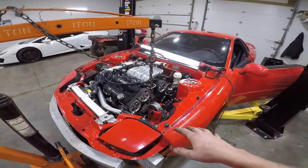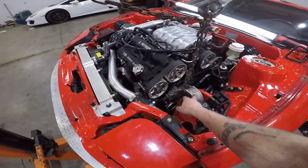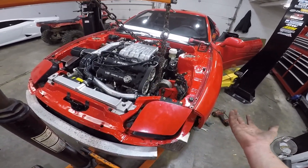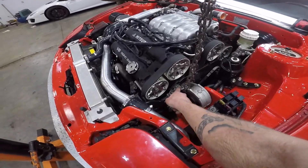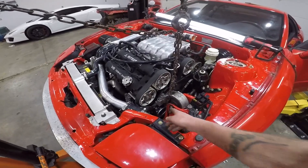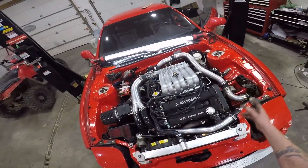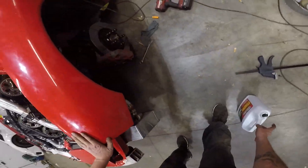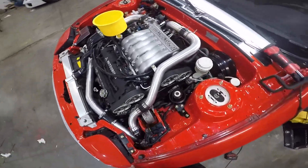I'm almost done. I just wanted to jump in here real quick while I'm doing this side motor mount. I've never ever been able to get this in without using my cherry picker. How do you line it up without one? You can't use a jack because there's nothing to jack besides the oil pan. So when you do your timing belt and get this off — if you don't have a cherry picker, leave it down in the comments how you're supposed to get this lined back up. If you get it tight here you're an inch and a half low, you gotta pick up the whole mount. I probably should have added coolant before I put everything back together — but I won that dice roll.